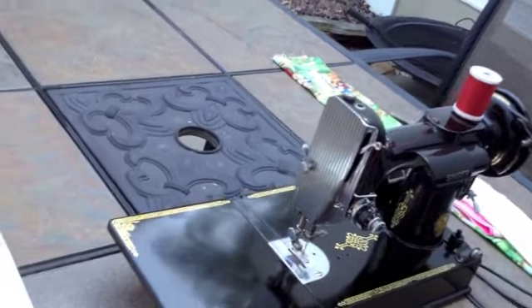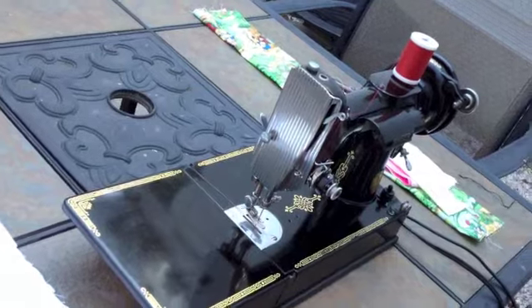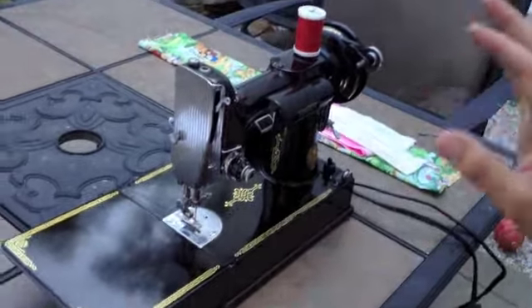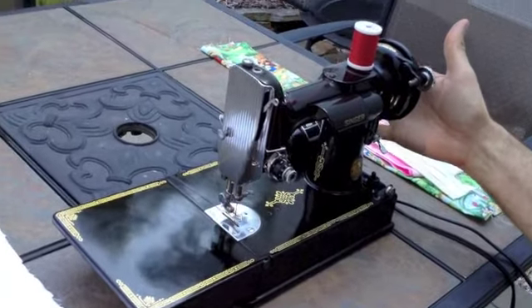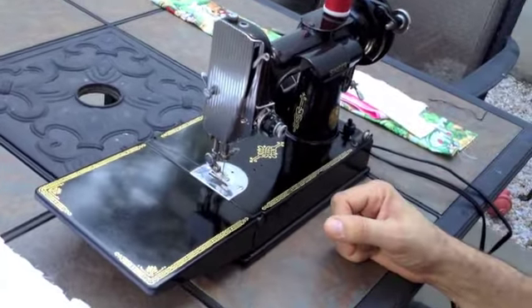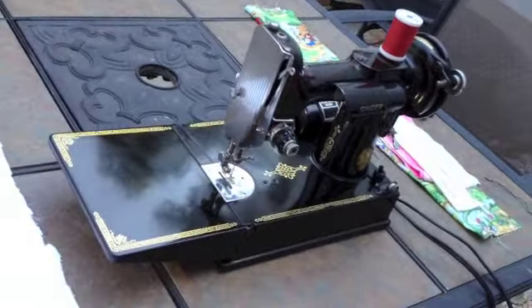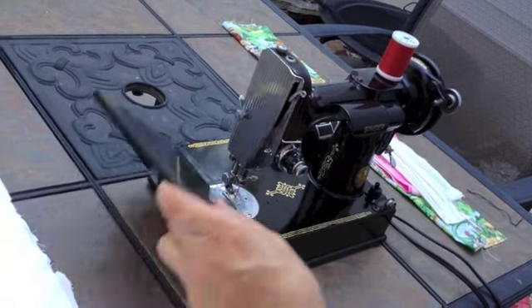It's very popular. This machine has had a number of service items performed on it. In addition to having the old grease removed and having new grease and new oiling, we installed a new belt, and we inspected the brushes on the motor, which are great. We've also put in a new power cord and a new foot controller pedal. So you have a lot of new items here, and of course it does come with the original bobbin case.